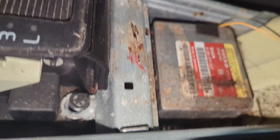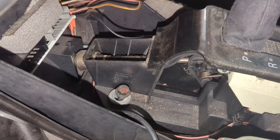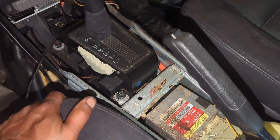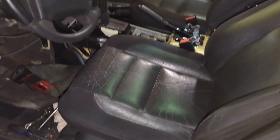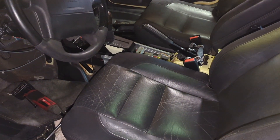Making some progress on the inside. Getting ready to break these two bolts loose on the side of this bracket so we can lift this shifter up. This shifter is beautiful — one of the few that's not broken on top from people climbing around in the car. I got the cable that goes outside loose, and the cable that goes up to the shift lock ignition loose. Now, a little tip: before you go pulling this car part for your manual swap, come inside before you disconnect your battery. Move both of your seats all the way back — anytime you got to take out the center console, move both seats all the way back. That'll help you.